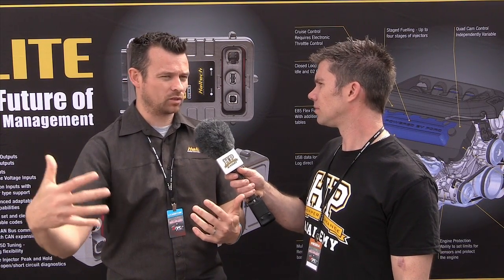On top of that, the Elite Series has what some people call a Z-axis or a fourth axis, where you can actually have multiple fuel maps. So you've got your normal fuel and ignition map, but you might say you want more fuel and ignition maps based on cam position. So you can have a fuel map based on cam position 0, 5, 10, 15 degrees, and each of those maps would also have a learning map behind it allowing corrections. You set up your target air-fuel ratio map, set up your fuel and ignition map, drive around, and the ECU will learn the target versus actual in each individual cell, apply that to a trim map, and you can import all that data straight into your fuel map.